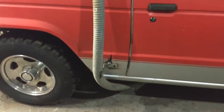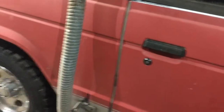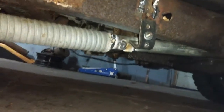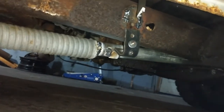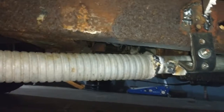I wish I had some of this stuff back in the day. Anyway, I had immediately had some ideas. You saw the way I had the muffler on the other video — well, I wasn't really thinking and I just sort of welded a piece of metal to that pipe right to the frame. But it was too rigid, snapped right off. I just moved it in the driveway and just the tension of it snapped it off.